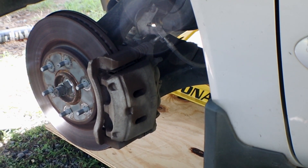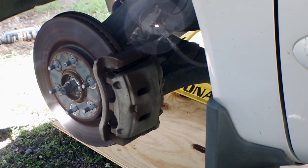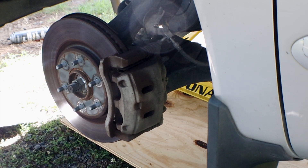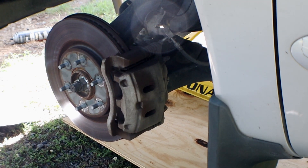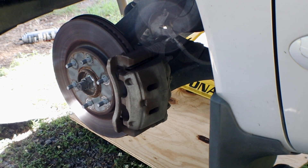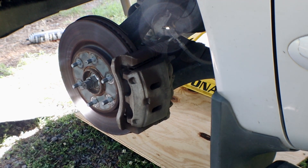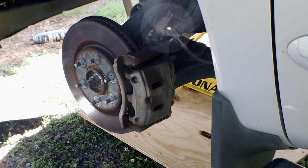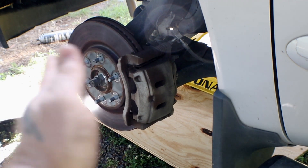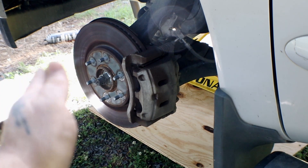It's a good idea whenever you're going to change the brakes. If you notice that your steering wheel shakes a little bit to the left or to the right when you apply hard pressure to the brakes, it probably means that your rotors are a little bit warped — either from riding the brakes too much or from hitting the brakes hard and then running over a puddle of water. The difference in temperature causes the rotor to actually warp, and that's what you're feeling in the steering wheel.